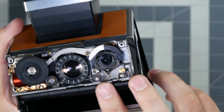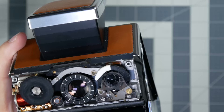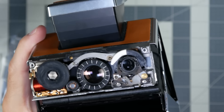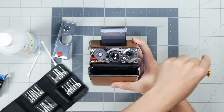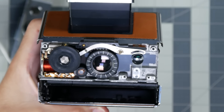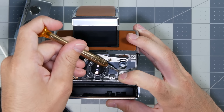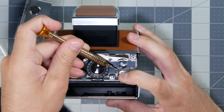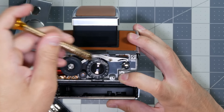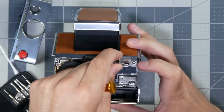This piece is the wheel that will lighten or darken your image, and we need to remove this to get to the actual light sensor piece behind it. All you have to do is remove the two screws at the bottom, and then it will come off as a single piece. Behind it is just a little magnifying glass that we have to pop off. I like to get a little screwdriver under here to work it off. A piece of this might break off, but you can use just a little dot of glue when you reattach it, so it's not the end of the world.